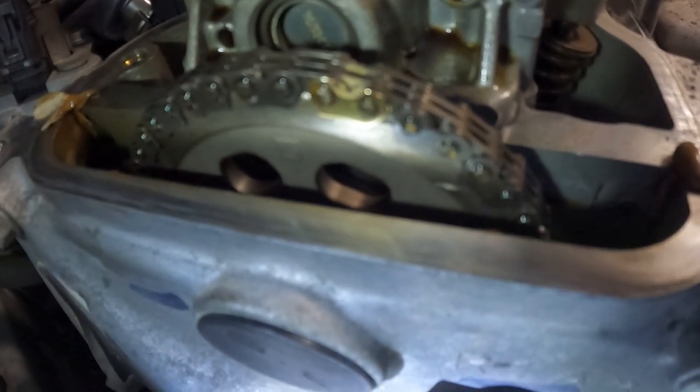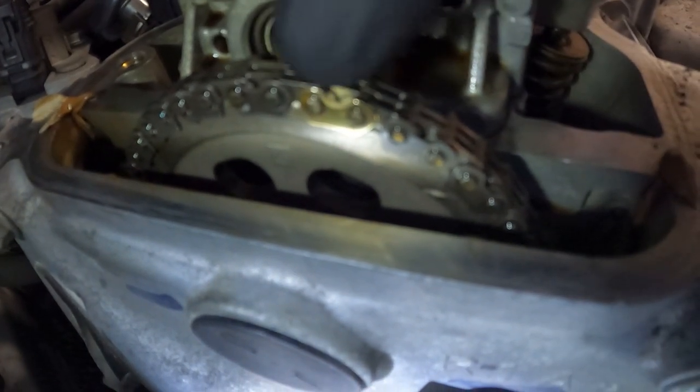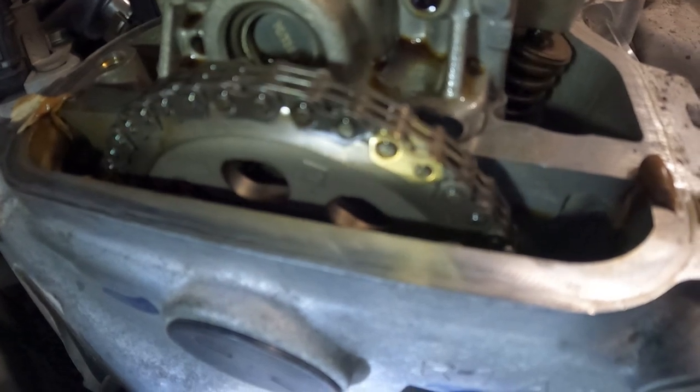And we'll get to that point. And look, once again, line there, cylinder four. Ignore this colored link. That is only for when you're replacing timing chains. That is irrelevant during a valve adjust. And then we will go again.